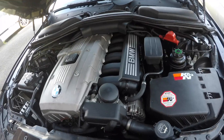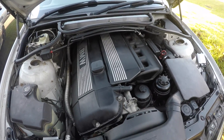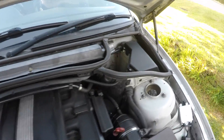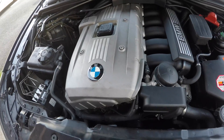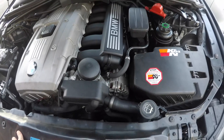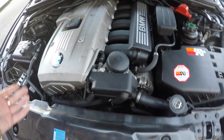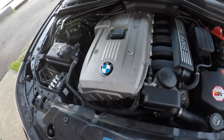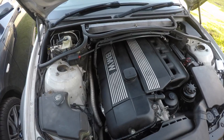The most common problem on E60s compared to E46s is electrical issues. On E46s you don't get many electrical problems, though in the US you get the GM5 going out and water getting in. On the E60 here, water gets into the brake servo rather than the ECU box. Both engines will strip head bolts if overheated. The M52 has an aluminium valve cover, which is better than plastic, but if it overheats that's the downfall of having an aluminium engine.